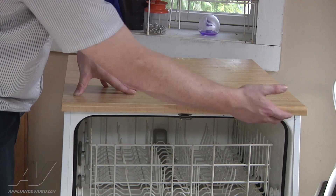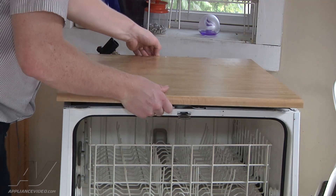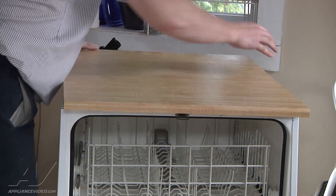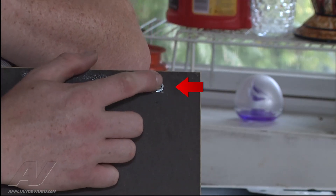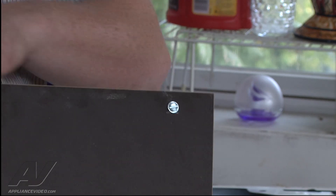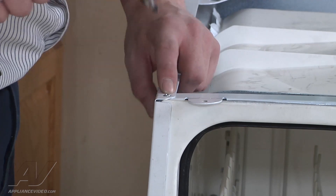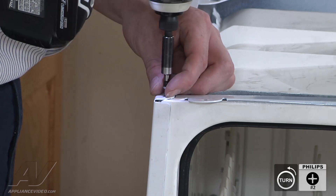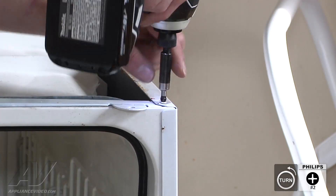Final step you're going to remove the last three T15 Torx along the bottom side here. After you remove the three T15 screws along the bottom, you're going to take the top, slide it forward, and pull straight up. These are the locks for the lid to lock back in on the rear edge — there's one here and one here across the rear. Now remove the last two remaining number two Phillips screws from the top. Remove your final one at the top.